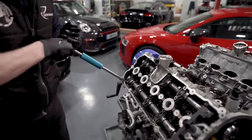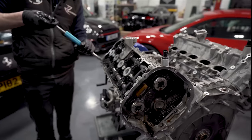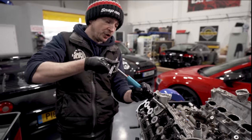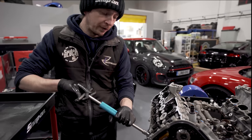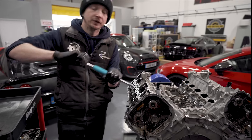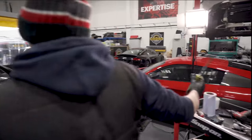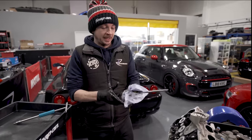We're doing well. So any differences or variations with this engine to the road-bound version? No, because it's a homologated engine. Yep. So they've normally got restrictors, so there'll be differences in the control systems, but engine wise, no. Which is why when you start looking at certain Huracan engines and certain R8 engines, which is very rare, the Decennium's got it, certain engines have got titanium valves. And that's so that the engine is homologated for use, so they can build a really rare trick engine with everything in and use it in racing. So they've got the future motorsport use in mind.